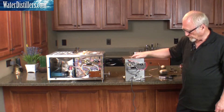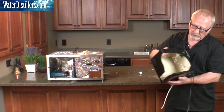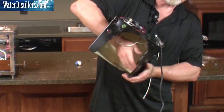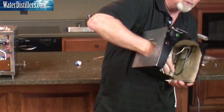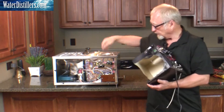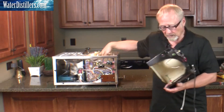This is the boiling chamber that you see in the unit here that's installed. What you're going to do is reach in and hold on to the heating element from the inside of the boiling chamber. And the same with the float, you can reach in to do that. So here I'm reaching in and getting a hold of the heating element. Whether you take it out, put a new one in, or just need to replace the gaskets, that's all done through the cover on the top.